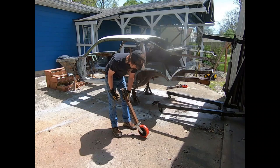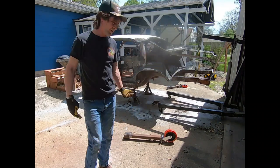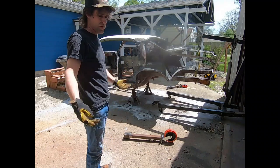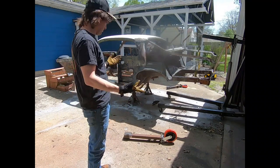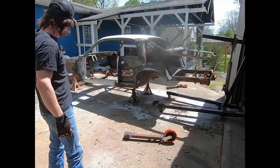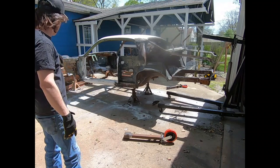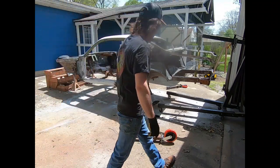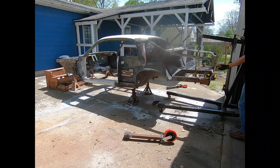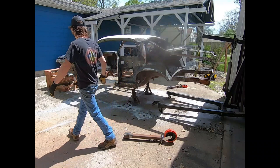Okay. So we're a lot higher, which means you're technically going to have to get the body of the car quite a bit higher as well. Poses a few issues with it like this. Really sketchy, just be careful. I put it's actually a hot tub stair step, very heavy kind of thing, right there in front of the jack. So my thinking is that if I go up and it decides to slide on those frame rails, it should peg right into that.